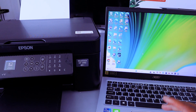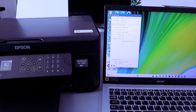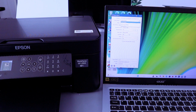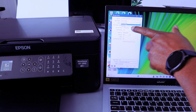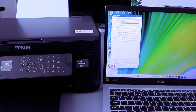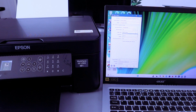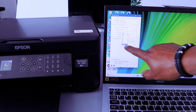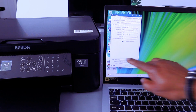Another way to scan is to use the Epson Scan utility — open it up. Scroll down and make sure you select the correct printer. Under scan settings, scroll down and select Document mode. If you want to scan a photo, select Photo. Set scan source to Glass Scanner, document type to A4, image type to Color, and resolution — you can scroll up to 1200 DPI; it is currently 300 DPI. Set rotation to 0, and after scanning select PDF.